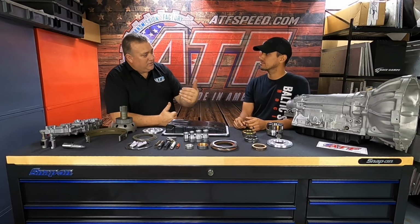I would always do that. You taught me that trick years ago. Right. Every time I always do that. And then we start pouring the fluid into the transmission. We do that for a couple minutes, and then we'll start running it through the gears.